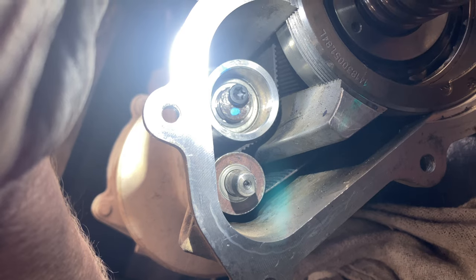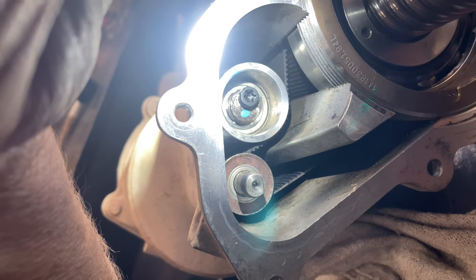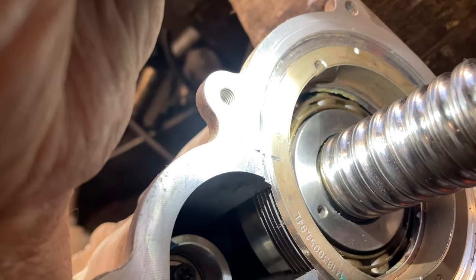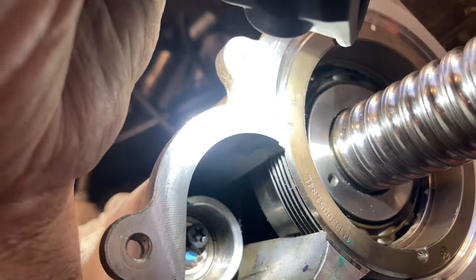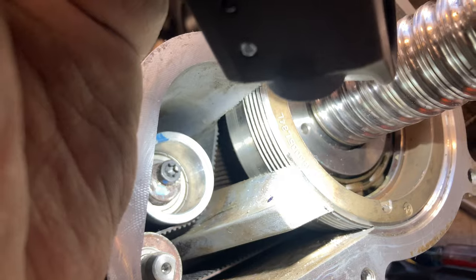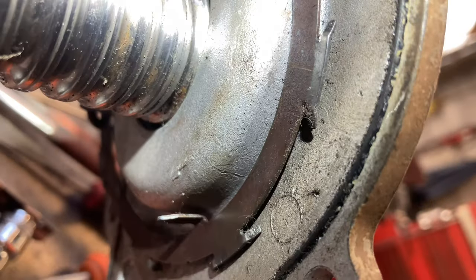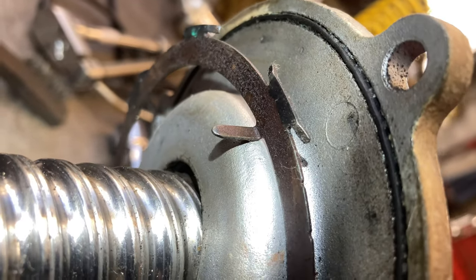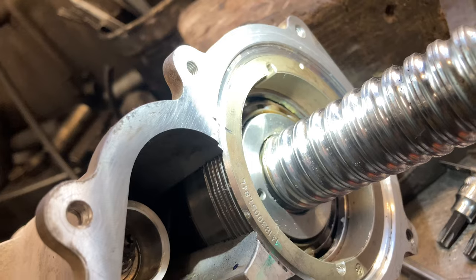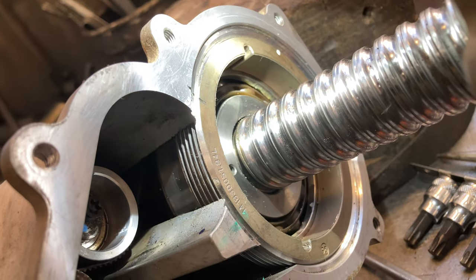You don't want to get that belt as tight as the E string on a guitar, but it's got just a little bit of give to it — it's back where it was originally. The belt feels good to me. I didn't pack that bearing because I didn't want that grease to fall out into the belt. That bearing only rotates about 20 times lock to lock anyway. We're going to clean the surface up and use Aviation Permatex on it because there's an o-ring in the cover. The o-ring looks good — it's not squashed out. Get that lock washer put back in to lock the nut in place, then put the screws back in and put it in the truck.